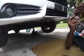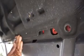You're gonna get your Torx. You might have to zoom that bit out a little bit. It's gonna be approximately 8 or 9 little screws around here for the splash shield. I took most of them out so it could be a little bit quicker. It's gonna be 3 in the front, and then you have 3 in the back, and also the little splash guard that's gonna be at the very front. You get that off, and it just slides out your way.